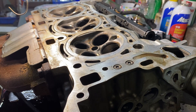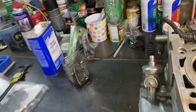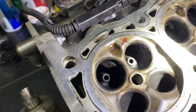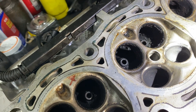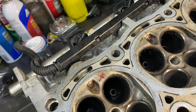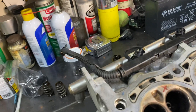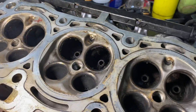This segment of the video is aimed at these filthy intake ports, which is very common nowadays on engines like this with direct injection. As you can see, just terrible. One of my sons worked at Lexus and they had a whole campaign on this issue — they used a shop vac and walnut blasting material to clean them out at the same time.